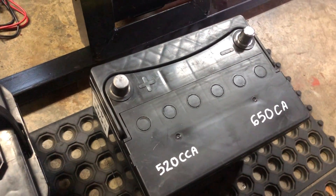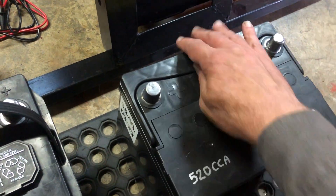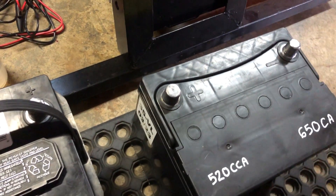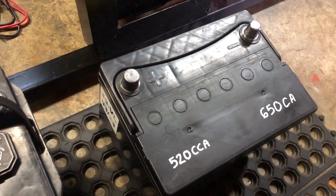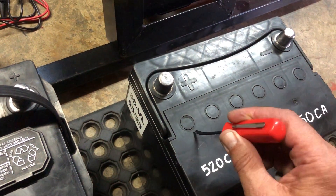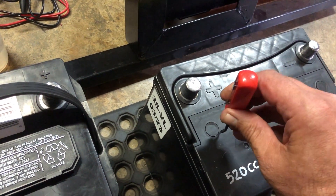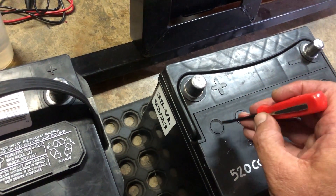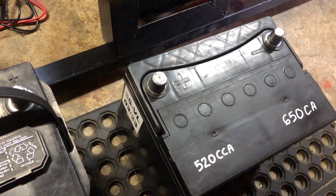For a battery with a slightly different design — flat top with a built-in handle — you don't see the fill caps until you remove the sticker. The sticker just tells you the rating, so I wrote that down with an indelible marker. To open these caps, insert a pry bar into the gap and gently go around and around. Don't pry too hard initially or you'll bend the lip. Eventually the cap will open and you fill the cells if needed.